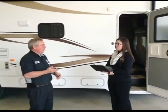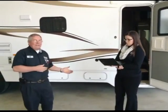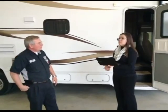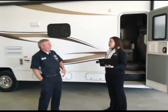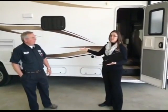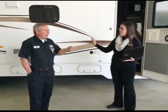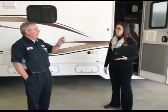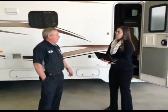Another thing I run into with generators, it has nothing to do with winterizing, but I've run into people that live down south and they say, well, it's so hot down here that when I run it, I take the cover off because all that hot air gets out. Well, the generator manufacturer says don't do that. The generator is designed to pull air in across and then blow it back out a certain way. And if you're opening up this door, now your air is being blown here and it's being sucked in from here. It's not doing the normal flow. You need to run these things with the doors on, the way they're designed. Otherwise, you could have hot spots in your exhaust, end up having an exhaust leak. Maybe there's a module that doesn't get adequate airflow if you open that up, and it could overheat.